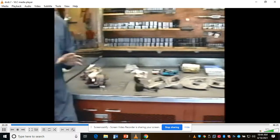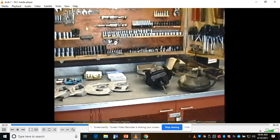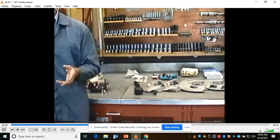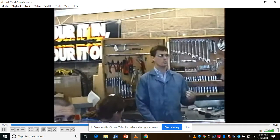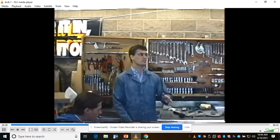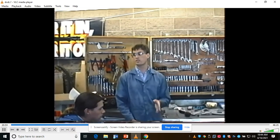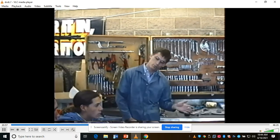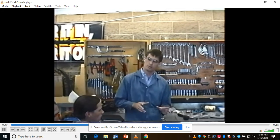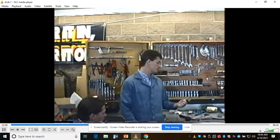Now, this disc brake conversion will work not just on this car, this '65 Chevy Nova station wagon. Any early Chevy Nova, let's say from '62 to '67, that came with drum brakes, this brake conversion setup will work on, like I said, any of the early Novas, '62 to '67, any Chevelle like Jason's, '69, all the way up through '72 on Chevelles. Novas, it'll work all the way through '74, okay? Because of the type of design of spindle, that's the limiting factor of years. When you go to later models, you use a different spindle.